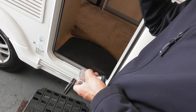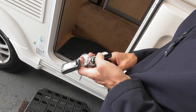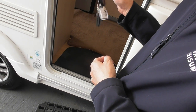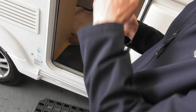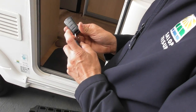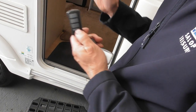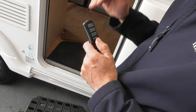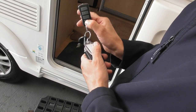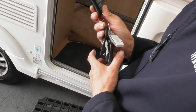and it's also got a PIR sensor. So if someone's moving around inside, it'll set it off. But obviously, as long as it's set. Yeah. Okay. And there is also another button, but on this particular model it won't work because it's for the higher spec ones, which would be an awning light one. Obviously, that's not connected to this particular model, and also it's got a program button so you can change the sensitivity of the sound of the tilt sensor and things like that. That is on there, but the awning light one is not on this model. Fine.